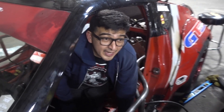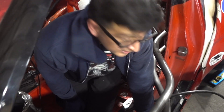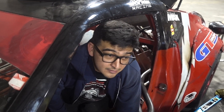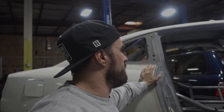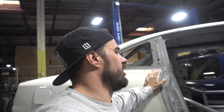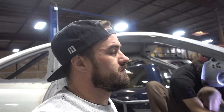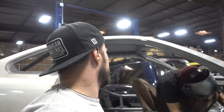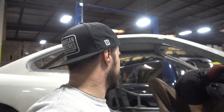He has options to keep door panels or remove them — there's never a reason to make a roll cage manually when you've spent all day doing it manually, which is good work especially considering all the bends and notching. But this was a whole cage done in a day. He designed and cut it in a day, and then we put it together in a day. We're going to finish weld everything on Monday, make a couple of base plates, maybe add a little down bar here to stiffen the chassis. We're contemplating adding a gusset or two, but it fits so tight I don't see the point — I think it's going to do a fantastic job just as it is.